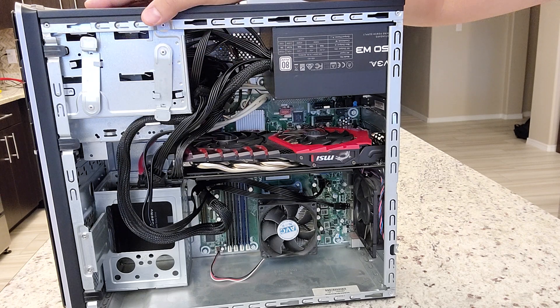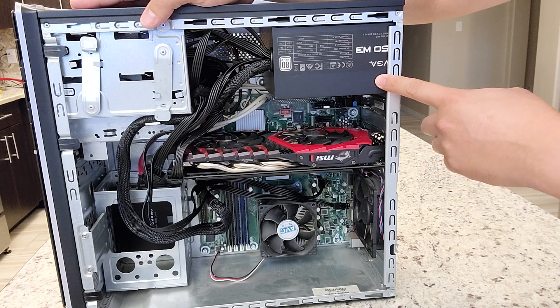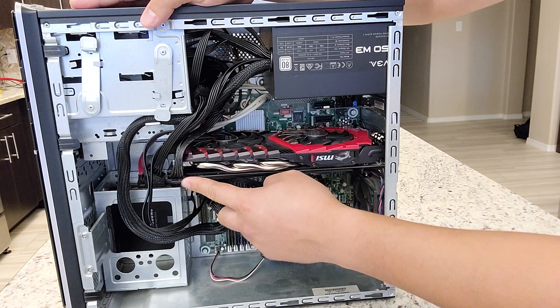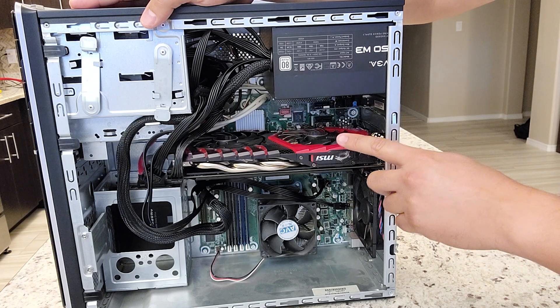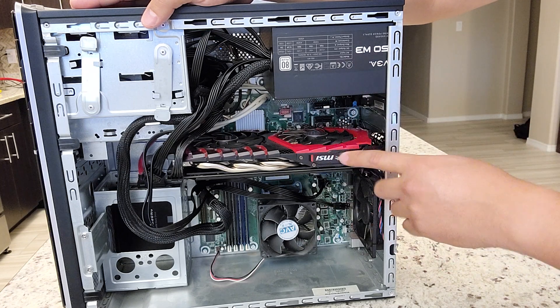Let me go ahead and show you exactly what I included on this PC. So there are a couple of things that you're like, hey, that's not supposed to be there — well, those are the parts that I technically upgraded. Starting with the power supply: the original was maybe a 250 to 300-watt unit and it really didn't have the connectors for the PCIe cable or for the graphics card. So I had to install a 450-watt unit. I did check the wattage for this graphics card, and 450 is more than enough.